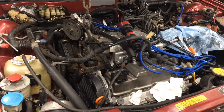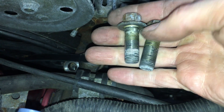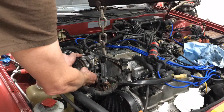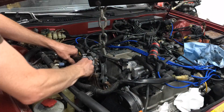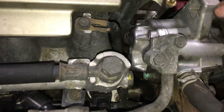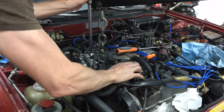Here is my new power steering belt. I tilted the engine to make more room to slide the belt under the mount. Now that I've got the belt in place, I can tighten the mount bolts to 40 lb-ft. Next I reinstalled the power steering pump, just hand tight for now. The pivot bolt will get 28 lb-ft of torque and the adjustment bolt will get 16 lb-ft of torque when fully tightened. If you look at the power steering pump on the back of this tab, there's a half inch square — I can use a breaker bar on that to hold tension on the belt while tightening the pump adjustment bolt.